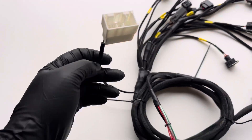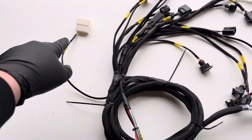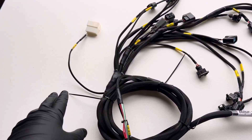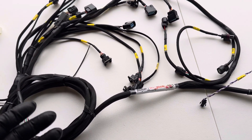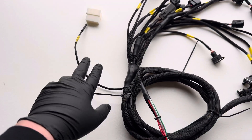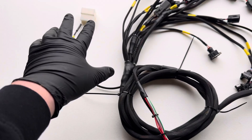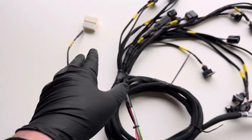We'll have the fuel pump trigger on the E-connector. It's a ground trigger. You must hook it up to a sub-harness for a chassis-specific unit. Or if you're not using a chassis-specific unit, you would just plug this to the factory 02-04 RSX to trigger the fuel pump. Everything else in the E-connector FuelTech does not use, so we removed it.